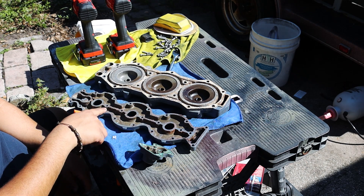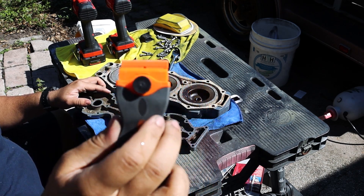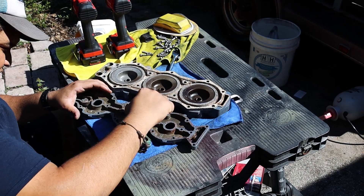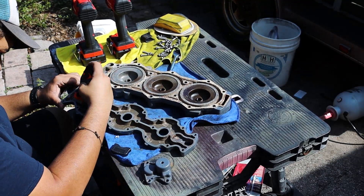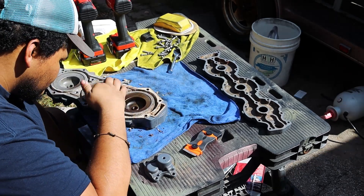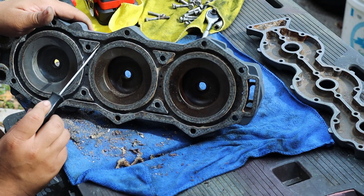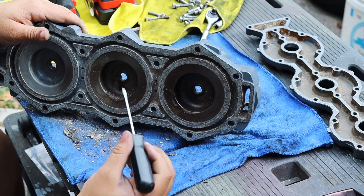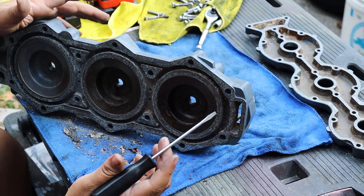So I'm going to start off by cleaning all of this old gasket stuff off the water jacket cover and the thermostat housing. Just grab a razor scraper — this one has a plastic and the blade side. I already started, but I'm scraping all the old corrosion, all of the residue, the leftover buildup that's in here with a screwdriver and a couple picks. I'm taking as much of this crap out of here as I can, just to ensure it doesn't clog as fast in the future and to prevent it from clogging in general.